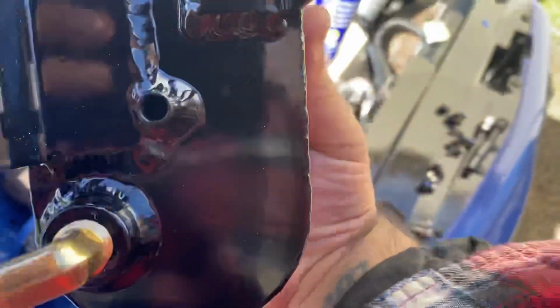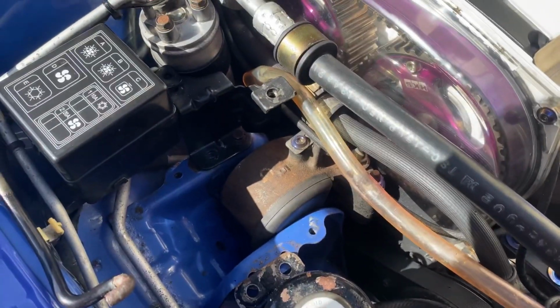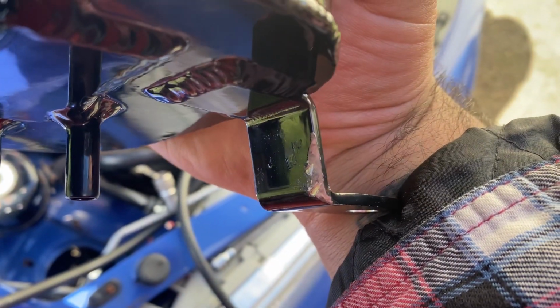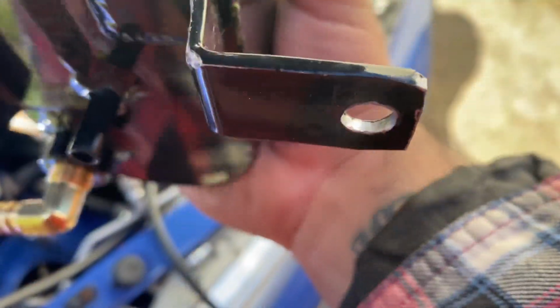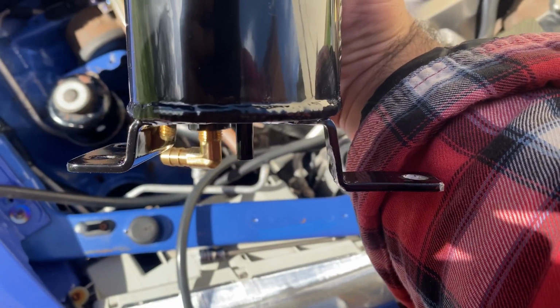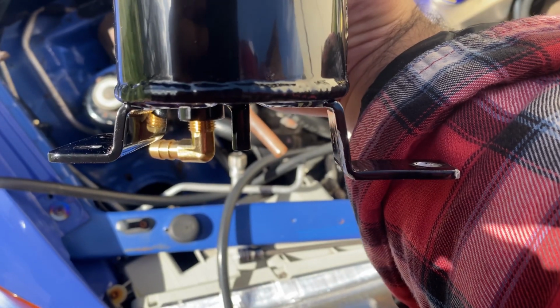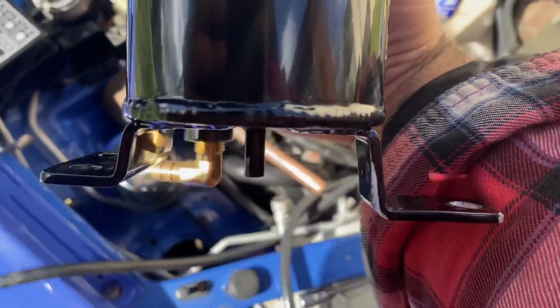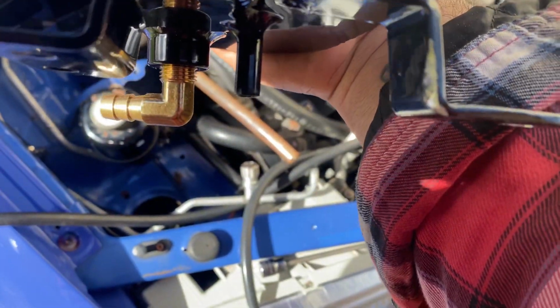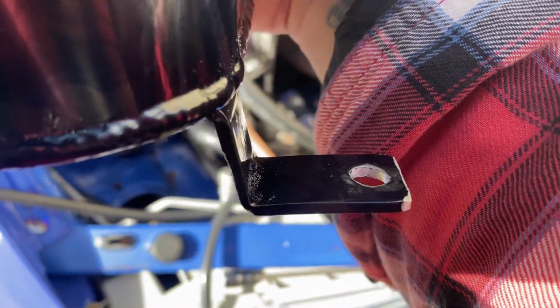Under here you can see this bracket is clearly touching the motor mount. The motor mount, obviously, one, this is aluminum, but yeah, the powder coating definitely didn't help, and the overall design didn't really do it justice. So if you see this right bracket, it pretty much needs to be pushed out like 2 millimeters maybe. It's honestly not even a lot. It just needs to be pushed out and then the hole drilled in a little bit closer right there, and then that'll be perfect. These front two bolt holes, they're fine. It's a little weird to get it in, but really this back one is the problem child. So yeah.